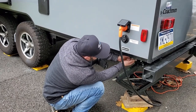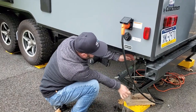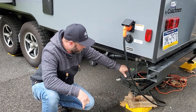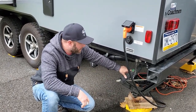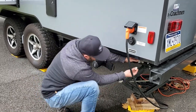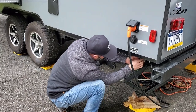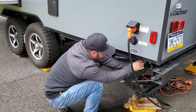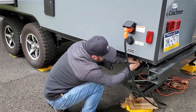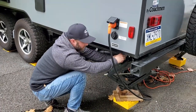These can be done by hand - they thread both directions. Pulling the plug out will drain any water in the system. It's very important you check these to get all the water out. That was the cold water line. Put the plug back in - it's a two-part system, so make sure you get both nice and tight so you don't have any issues when you fill it back up in spring, or leaking throughout the winter if any antifreeze would leak.